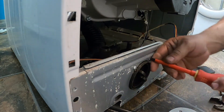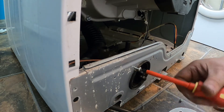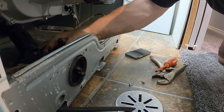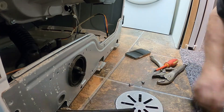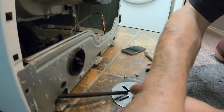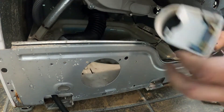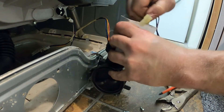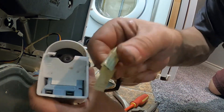So we'll grab our Phillips and take out these last two screws. Just pay attention to the length and the type of screws that are here, because they're different than the ones that were holding the sheet metal together. So that's the two last screws. We'll pull this hose off for the drain that we were just draining into the floor drain, and put the cap back on there. Now we're just going to pull out the pump. It's got a couple of wires going to it — just remember which one is which. In my case, light brown is on the top and black is on the bottom. Yours might be a bit different but it should be similar. They're just spade connectors, so you just pull them off.